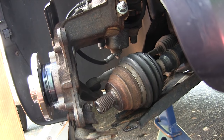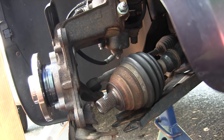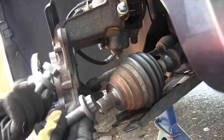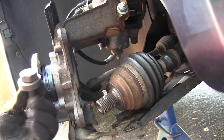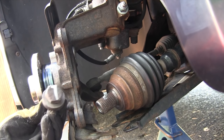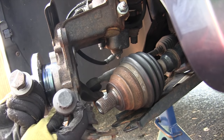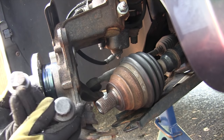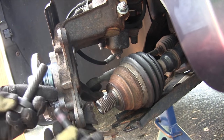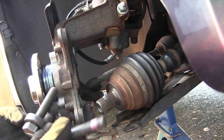When you install the axle into your new hub bearing, apply a little bit of anti-seize to the splines so they won't be as seized in the future. Note the torque spec — there are two different kinds of bolts used on these cars: a 24mm 12-point head and a 27mm hex head with a big thick washer. One has a washer and one doesn't, and they're also different sizes and point counts. The torque specs are extremely different, so if you use the wrong one you're going to damage your new wheel bearing.